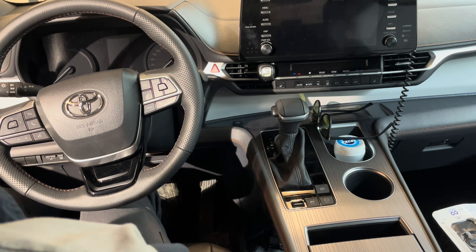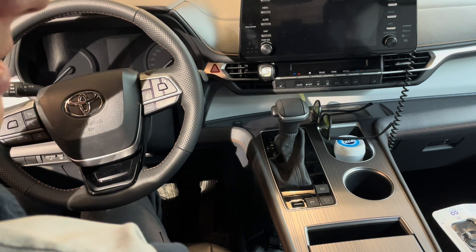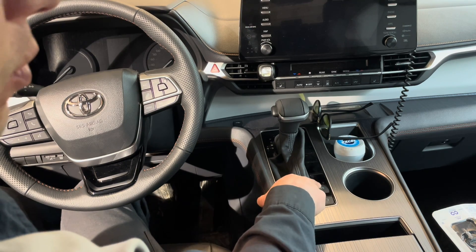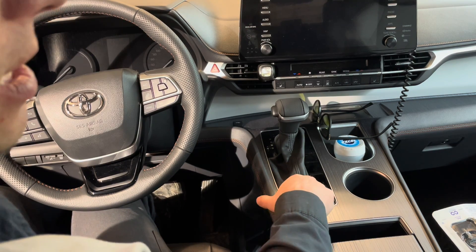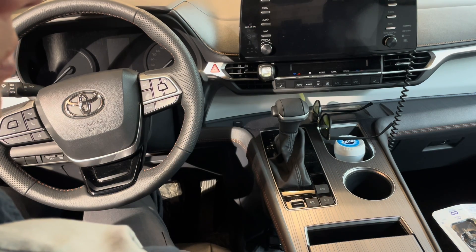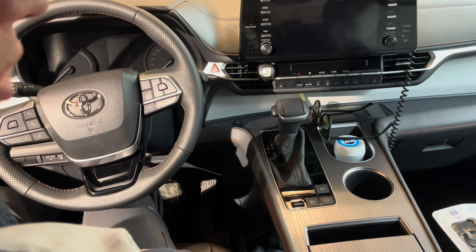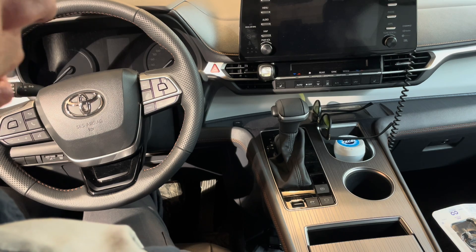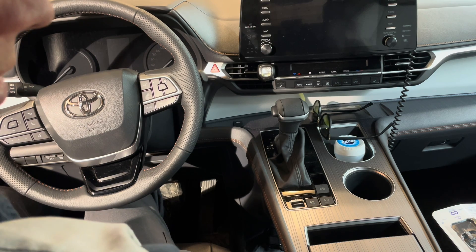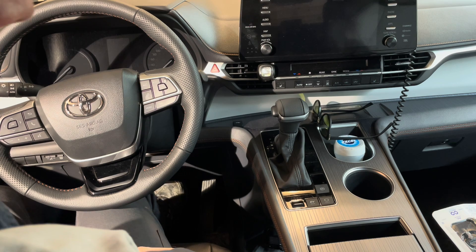After that, you will see the little parking brake light on the dash flashing rapidly four times a second. After that happens, we're going to take this button and push it and hold it for five seconds. After we hold it for five seconds, that will start the retraction of the rear parking brake motors on both sides, and then they will retract completely. Once the light starts flashing at one-second intervals, that means the motors are fully retracted and we can shut the ignition off and do the brake work.